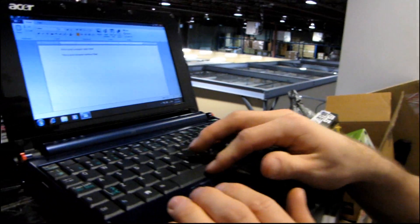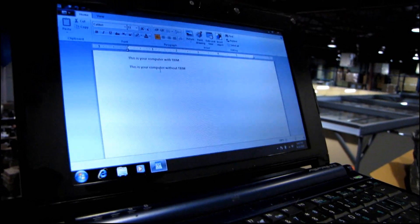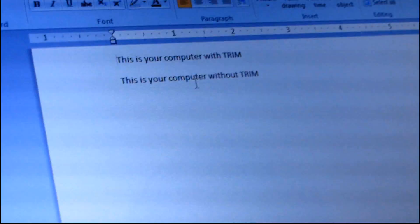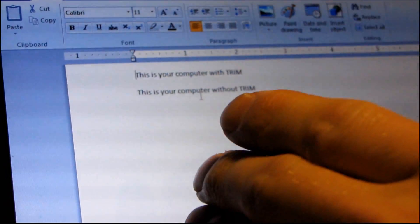The question is: what does TRIM do? So here's what TRIM does. TRIM is kind of like the insert key, because normally with any SSD drive the performance is actually going to degrade as soon as you take that fresh, never-written flash memory and write over it once.